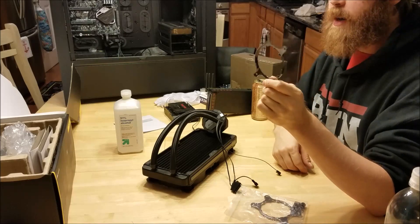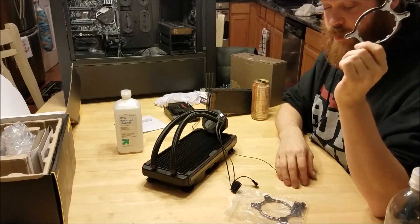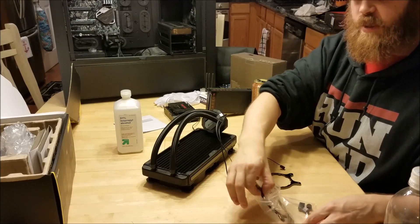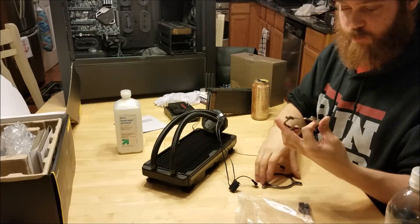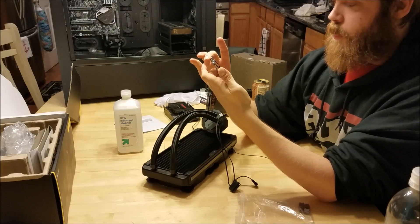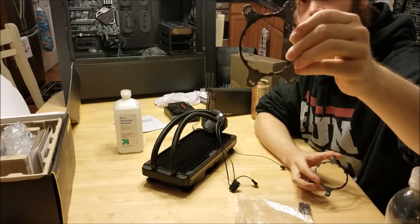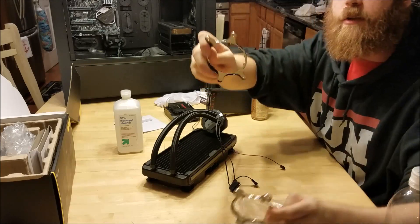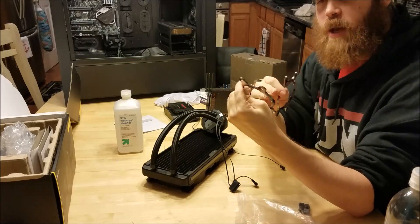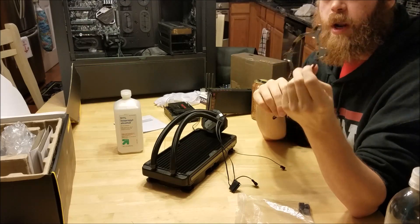This is actually the AM3 bracket, because I was originally just going to use it since the AM4 was taking so long. But the AM4 bracket is here now. I want to hold them up to compare, because it looks like all they did was drill extra holes into the existing AM3 bracket. Inside these brackets there are two holes in each cutout section instead of one — one hole lines up with AM3, and the other is for AM4. So all they did was come out with the same bracket but with extra holes drilled, making it usable for AM3 or AM4.